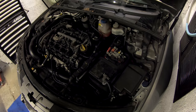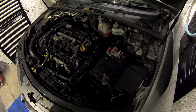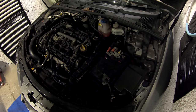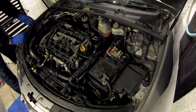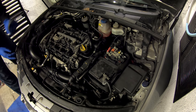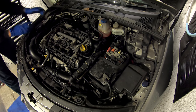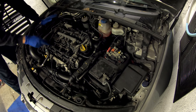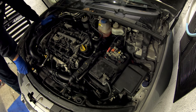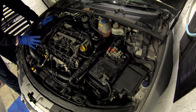I'm hoping there's enough light in this garage for you guys to see on camera. I think you can. So, here's our broken belt. I've already took this cover off to confirm that it was a snapped belt. It's stuck on the teeth down there, so it's not an issue at the moment. What I want to look at is the rocker arms underneath this cover.